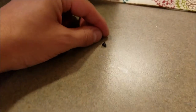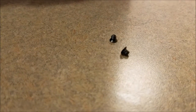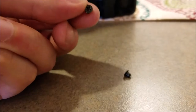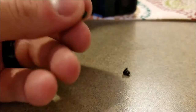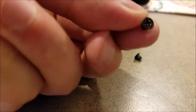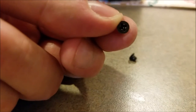On the left side you've got these tiny, tiny screws. Make sure you're using a decent screwdriver, the right size, or else you're going to strip them out. I almost did strip them out, so be careful.